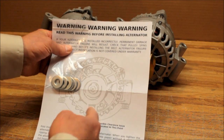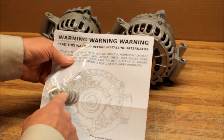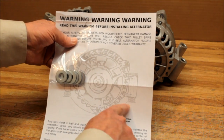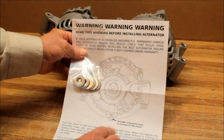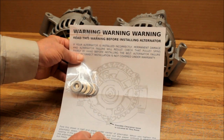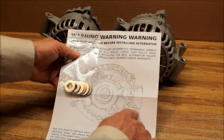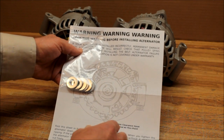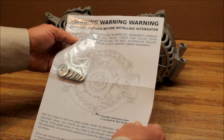Put the piece of paper under the center of the alternator, push down, and if you can pull the paper out easily then there's enough clearance. If you push down on the alternator and try to pull that paper out and it sticks, then you're going to have to use the spacers. There are enough spacers for two under each pad — three mount bolt holes, so six spacers total. Start with one washer; if it still hits, use two. Never had it go over two washers.